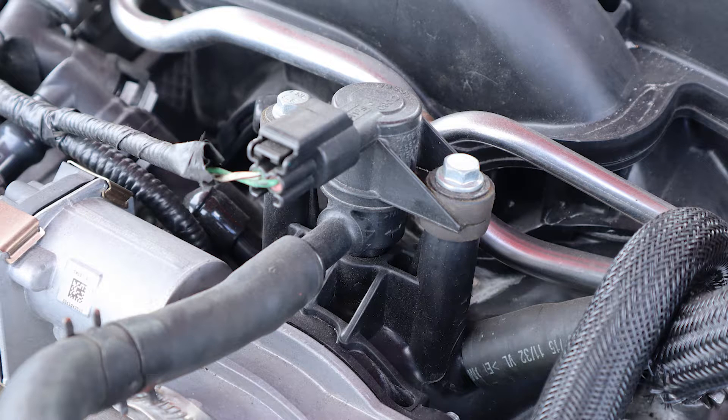The purpose of it is to basically move fresh air to the canister purge system that's attached to your OEM gas tank. In most cases when you're doing an engine swap and putting this in an older vehicle, you're not going to have any of these emission systems on the vehicle to continue to use. So this valve gets left on the intake manifold with no purpose whatsoever, potentially causing vacuum leaks or just being unwanted.